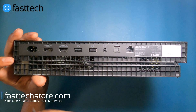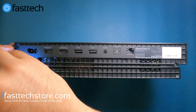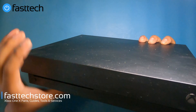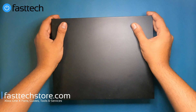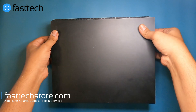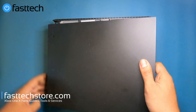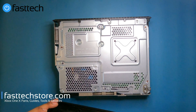There's another T10 screw on this side with no sticker on it. Once these two screws are out, we're going to remove the top end of the case — move it to the front, then up, and this side comes off like that. Then you pull it off by pushing it down. It's a bit complicated but that's how you take it off.